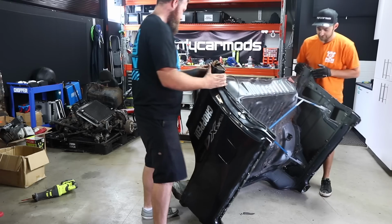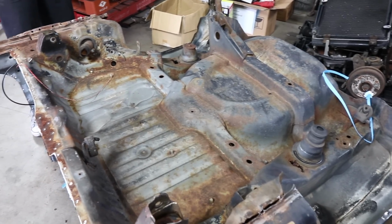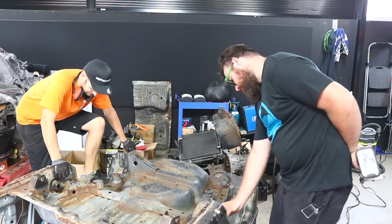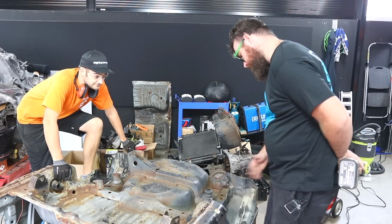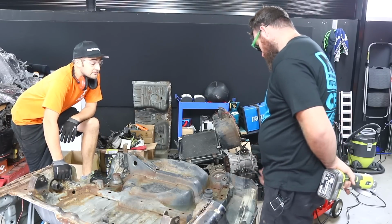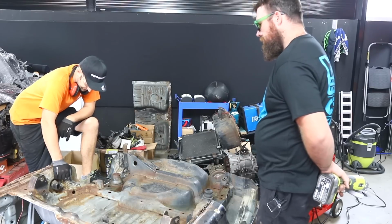So we've got to push forward and use as much of this as we can. Rather than rust treat the entire rear cut, we're going to cut the floor down to the bare minimum we need to make it work. So I think when we're going to separate this, we'll actually cut probably 20 mil to the junk side of the seam. Yep. Take all the body off that we don't actually need. And then we can get a lot better access to all the seams and take it off neatly. And the spot welds too, right? Yeah, because a lot definitely